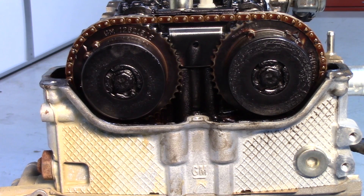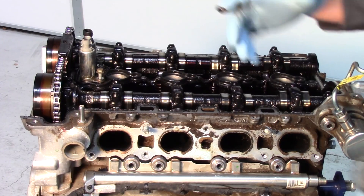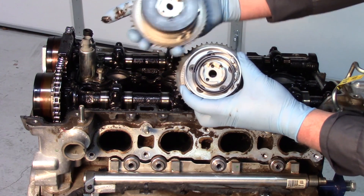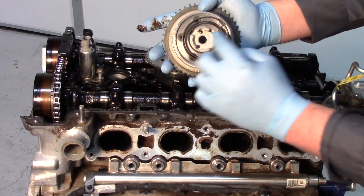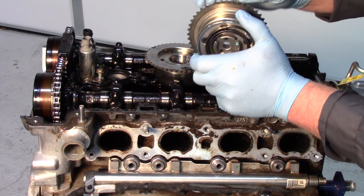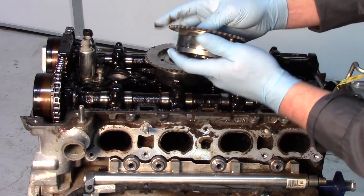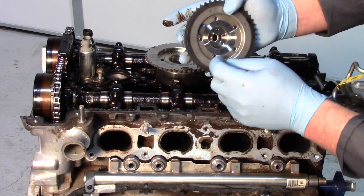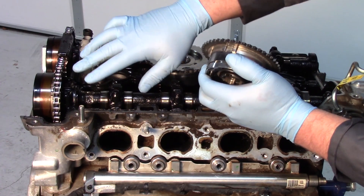On the front of the engine here we've got the valve cover off and you'll see the two different cam actuators — we've got the intake and the exhaust actuator. I've got a brand new one here; they're actually the same for both cams. If I pop the plastic cover off you'll see the return spring in there. These two pieces decouple and move the part physically attached to the camshaft, causing cam advance or retard. On the back side you'll see a little alignment dowel that goes inside on the camshaft.